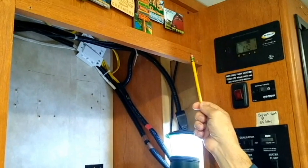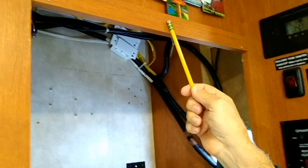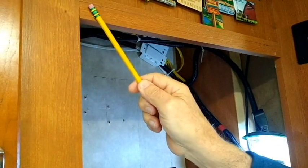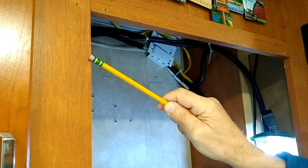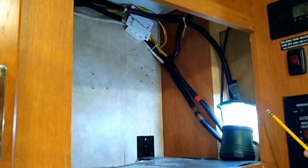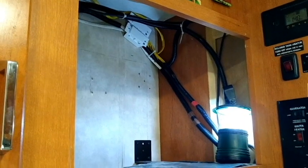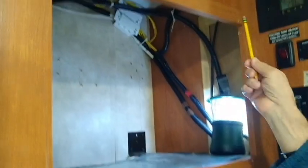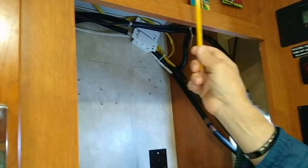There's a faint line on the edge here. This is where I'm going to have to remove material about an inch at the top and about a quarter of an inch on the side in order to get clearance to slide the unit in. And the flange will cover beyond that, so the new flange over the edge of the microwave will cover any new holes made by the saw.